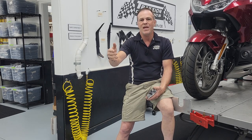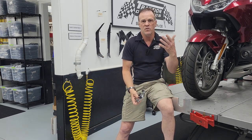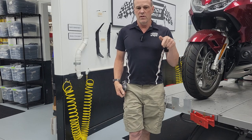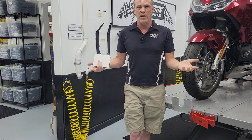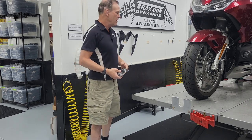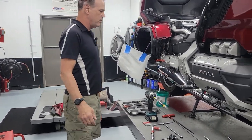Most people rode between 7 and 10 out of 25 on the old bike. When you hit the adjuster and go to one-up-with-luggage on the new bike, you're already at like 14 — stiffer than most people would care for. In its current configuration it's basically useless. Now I've made a part where you'll remove your seat, loosen a lock screw, turn the adjuster to a new setting, reset the lock screw, and put the seat back on. In this video I'm going to combine that with showing you how to install it, so come on over here. I've already removed the side covers and seat — most everybody knows how to do that.